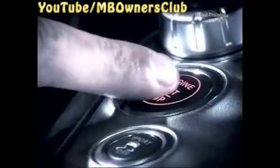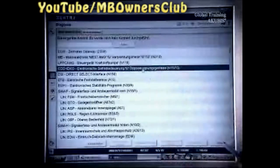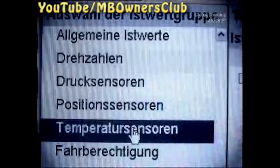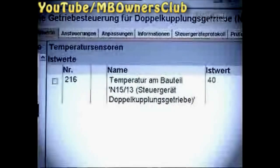If the engine loop circuit was open, then you need to fill the transmission fluid again. To do this, let the engine run for a minute. Now select the fluid temperature and start diagnosis. In the dual clutch transmission control device, click on the actual values and you reach the temperature sensors. The transmission fluid may be no hotter than 40 degrees. If so, allow it to cool.